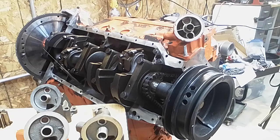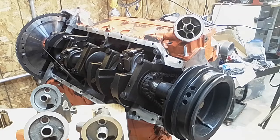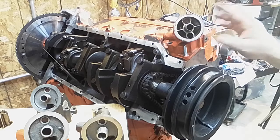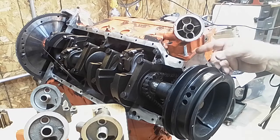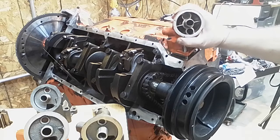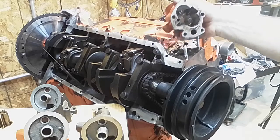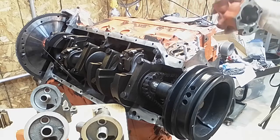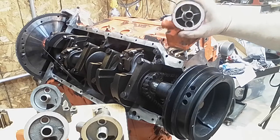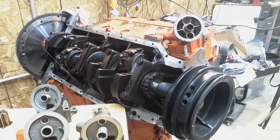In this video, I'm going to talk about the 472-500 Cadillac oil pump. The factory oil pump that will come on the motor is an aluminum housing, and it has this oil filter adapter. The gears are inside the pump. It's an external mounted pump with a drive rod that goes up to the distributor. These just bolt on to the outside and hold the filter.